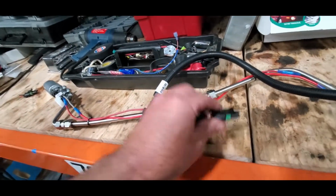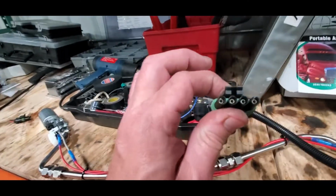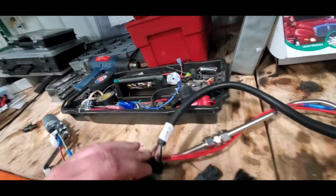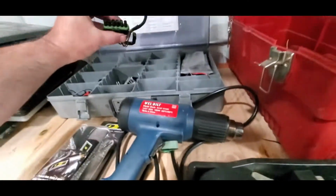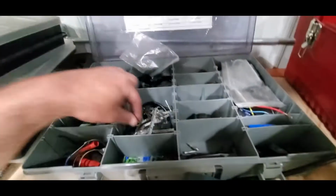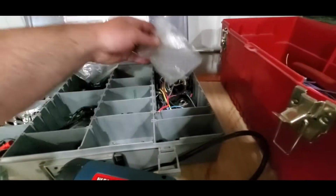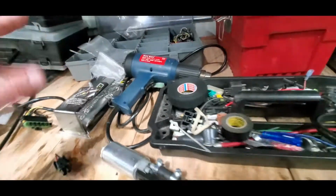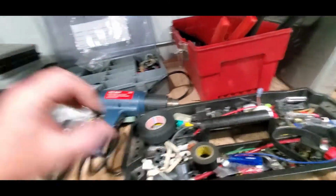And the sender we will do on a 2 flat, but we will reverse the polarities, which is really easy to do on these because you can do all kinds of things to key them. You can do them with the pins. You can do them because you got the females here, and well, that one's also female. Let me find some male pins. Those are all female as well. I'm short, so somewhere in all this mess will be. Those are all female. Oh, we might be in trouble. Oh, here's some male pins, so you can see them here. So you can swap the keying on that. You can swap the polarities here. You can go to different shapes if you've got multiples, you know, squares or flats.